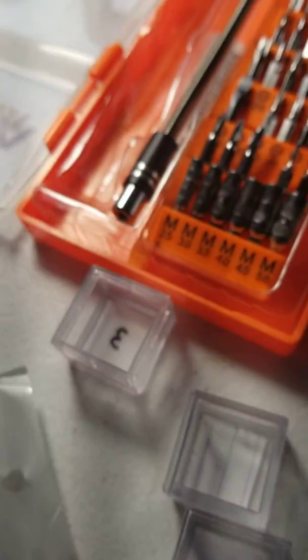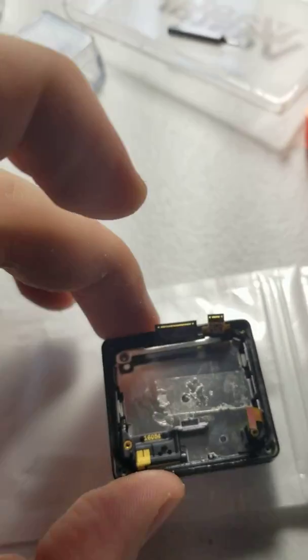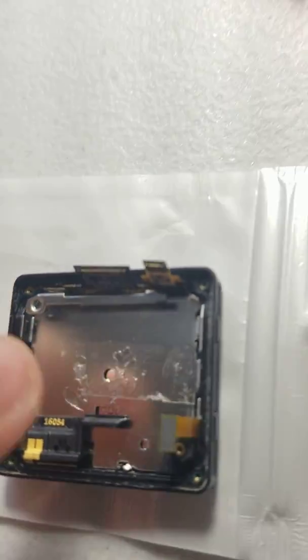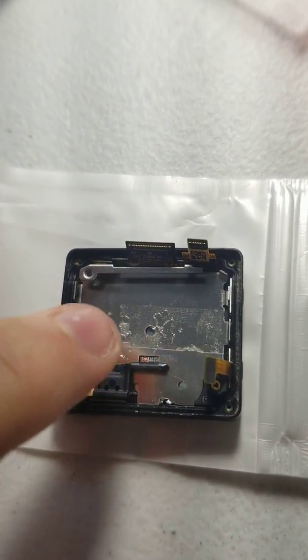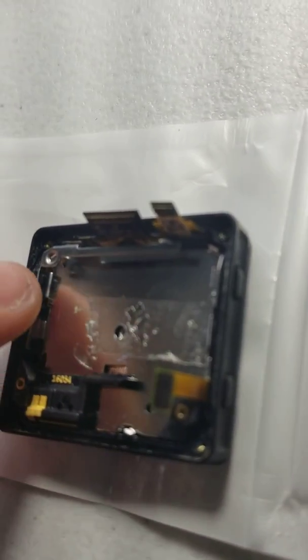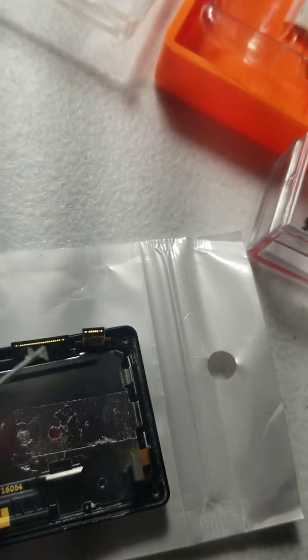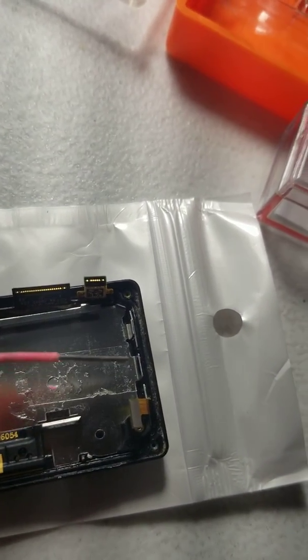You want to take it and ideally put down something soft that's clean. Take it, turn it over and then put your tray back in, and you'll see that these little clips will make a nice little pop once you snap that little retaining tray back in. You can see this is where the battery was with the adhesive, and once it's in, you'll hear a nice little click and it will sit in there. This clip right here snaps on, and this little clip here snaps on as well.